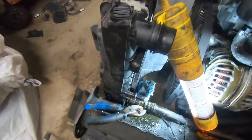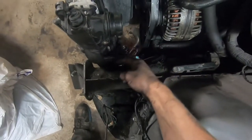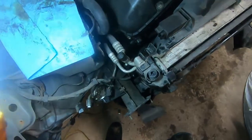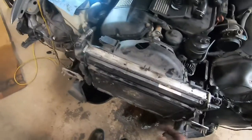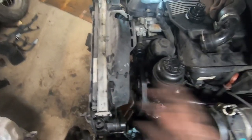There's an AC condenser and all these components because they were all damaged — so you don't need to do that if you're just doing the rad. Once you have all your hoses disconnected, since I am pulling off this entire thing, I had to disconnect the two power steering lines. The only last thing you have to do is get the refrigerant extracted from the AC system — I need to get someone to come in and do that. Once that is done, this whole entire piece will come out. If you are just doing the rad, you do not need to do all that. You just have to undo the shroud with those couple of bolts and remove the fan from the clutch or the entire assembly with the 32mm wrench.